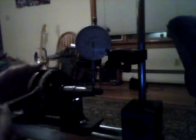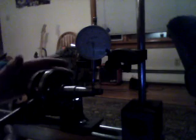Basically, all you're going to do is just keep doing this until you get it right. I actually started out with it pretty quick. That's -3. It's about 0, so I need to whack it again. So it's -3. Again, always hitting that end on the lowest. That's a little less than -3. That's a little less than -1. So now I'm only 2/1000ths out.